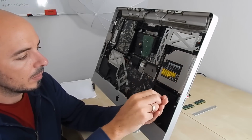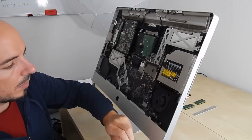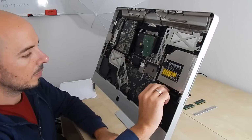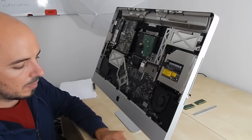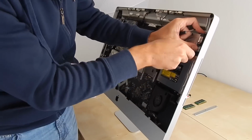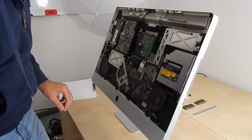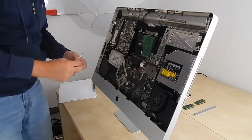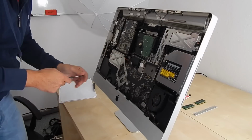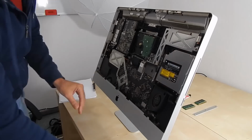Now starts the serious game. I have to unscrew all the screws. Maybe I should take out the fan, but it's not really necessary. But anyway, I have to take it out in order to clean this, because when you open the case, it's a good time to clean also the case, and the fan has a lot of dust on. And then I have to take out all the screws in order to bring out all the motherboard, the main board of the system, because the graphics card is attached over this board and it's behind, as we see the motherboard when we open the iMac.